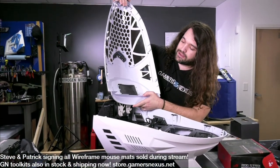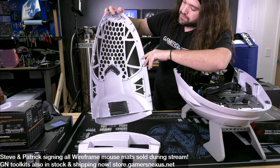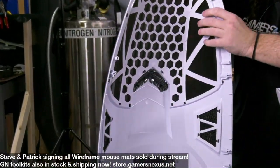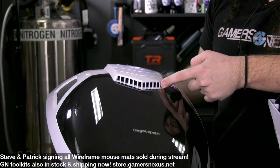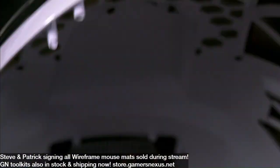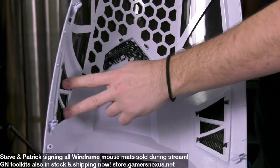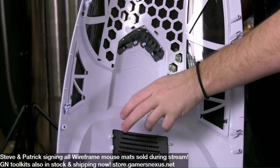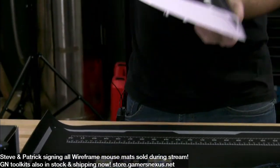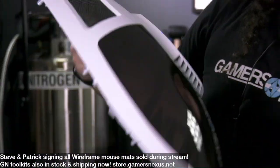The inside, it's technically got some dust filters, I guess you could call them that. Let me get this down on the table where we can see it better. So there's a little bit of ventilation here where, if you look at the front or the top, aligns with this. If you could fit a small tower cooler in there, that would be kind of interesting. Don't know that it would cool particularly well, but it could technically pull a very tiny amount of air from that spot. There's some holes on the sides. No fans aligned with these, so this would only really do anything for you if you're negative pressure and the air is coming in through wherever it can. Hole back here with a grill on it, and not particularly efficient in terms of the amount of airflow potential in the design in general, but that's where it's located if you were worried about it.